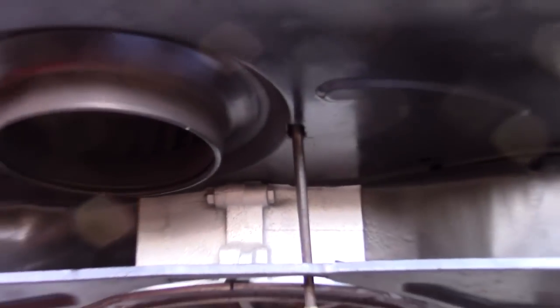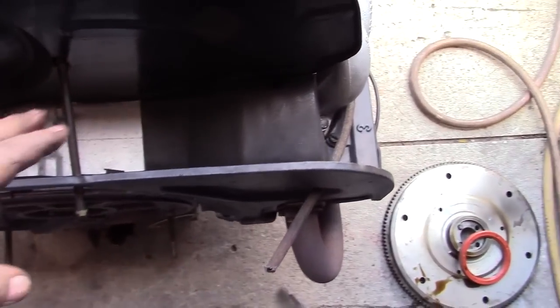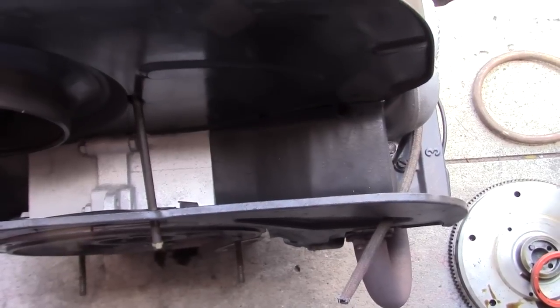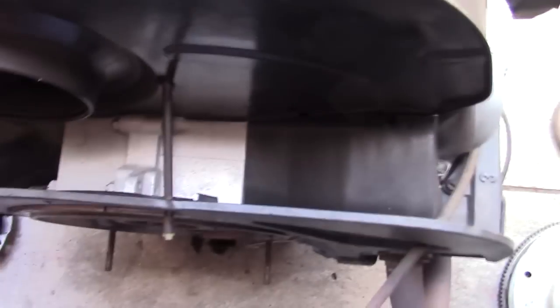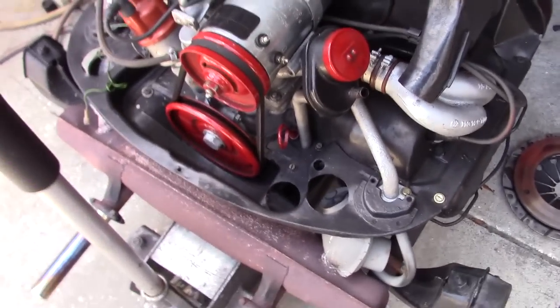This is a dual port motor. I think this is probably, you know, definitely we determined it's a car motor. The biggest problem that I see with this motor in a bus is the oil cooler, or lack of it. We have a car oil cooler, or an early model oil cooler, inside the fan housing. I like in a bus to run the later stuff, the doghouse that's outside of the fan. It also has a larger fan for more CFM over the motor as far as airflow.